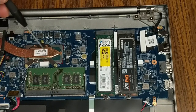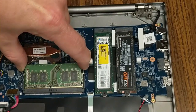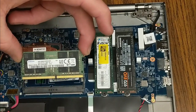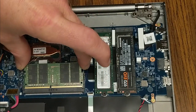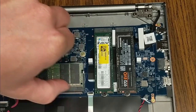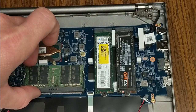Next we're going to switch out our RAM chip. The RAM is only going to fit in one way because of the notch — if you try putting it in the wrong way it won't fit. Flip it around, go ahead and insert it, gently pushing it into the slot, making sure it's making a connection, and then snap it down into place, pressing on it gently to make sure it's making all the connections.